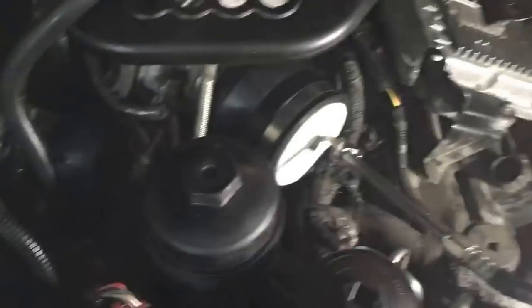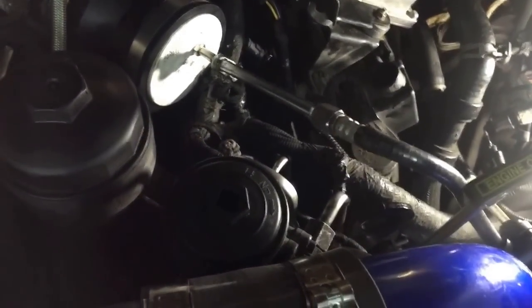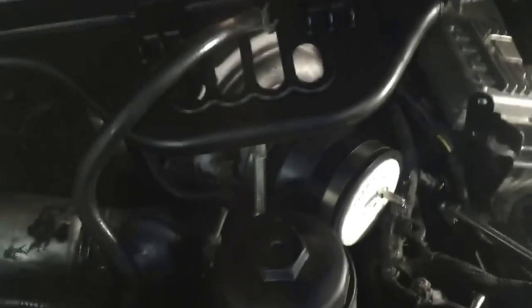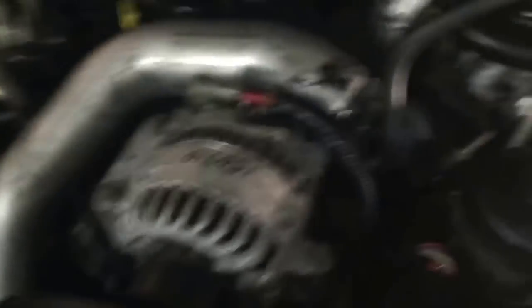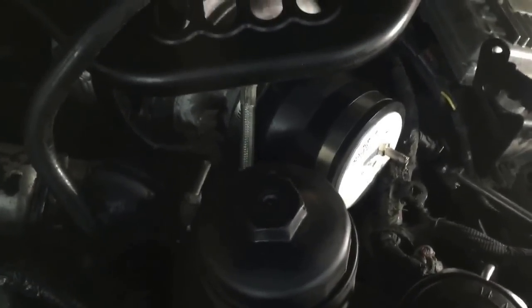What you do is use a little bit of air to pressurize the system area. It allows me to pressurize the hoses and it'll pressurize the whole boost system, so I can see if there are any boost leaks as well. This is a cool little trick.